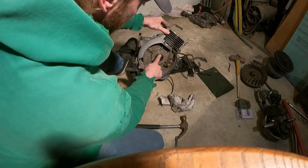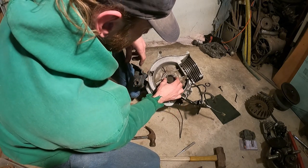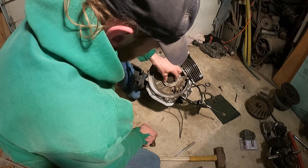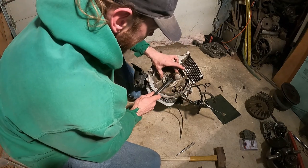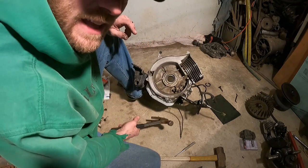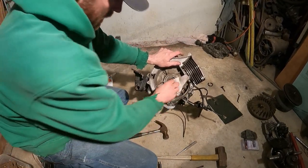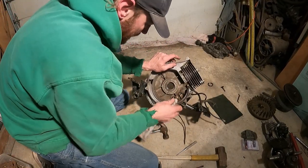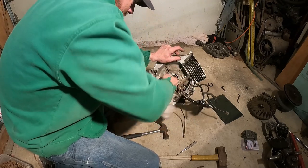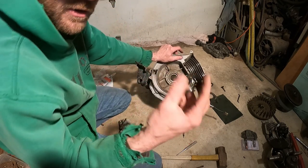So I need to take the seal out. Okay, so what I ended up doing is this was in here like this. And I was able to get the claw of the hammer in behind there and yank like that and got her out. So this side is out. Awesome. That's one thing we can be done with that. Just run the rag around there, make sure it stays nice and clean. Bearings in great shape. So now all we have to do is put this back in.